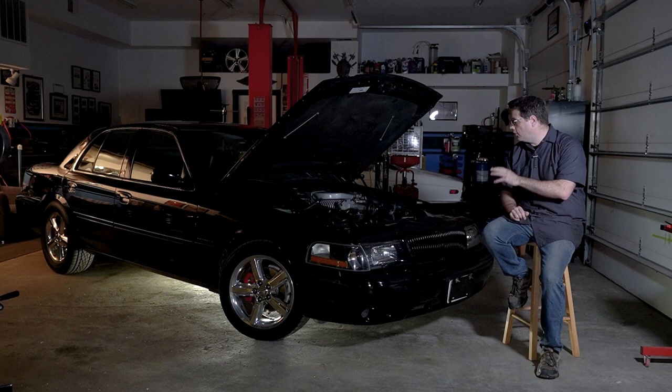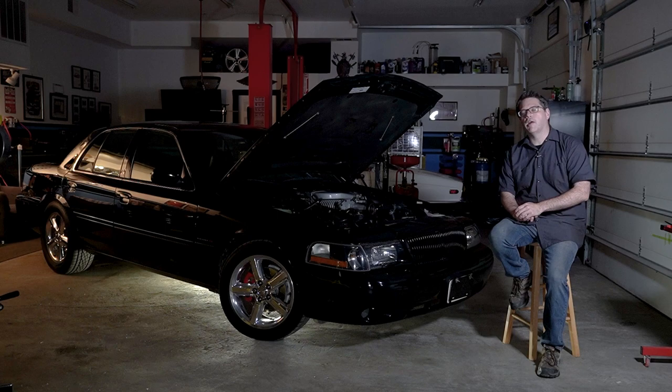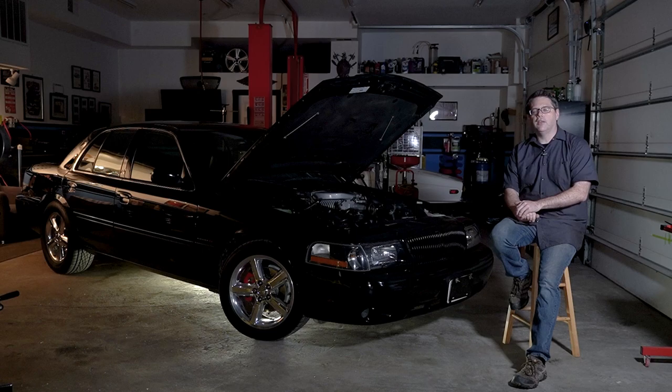If that happened, what already had minimal threads now had even fewer, increasing the risk of a blowout. That was always something that came up, and I've owned this car since 2005 — it was certainly a big factor on a lot of the forums back in those days. We were often using Motorcraft spark plugs, so you'd go ahead and put anti-seize on them.